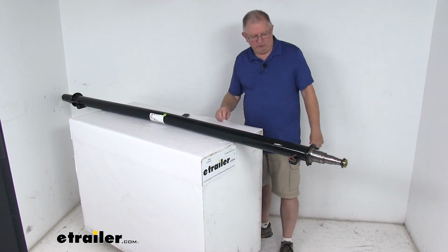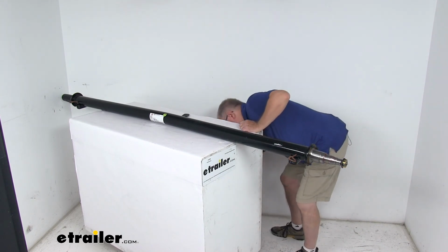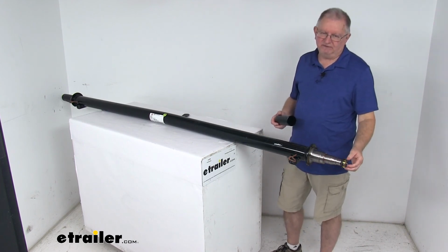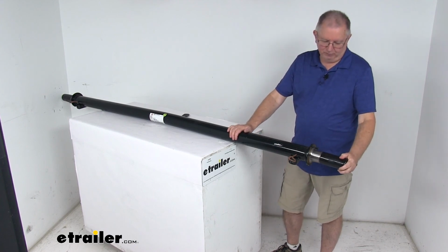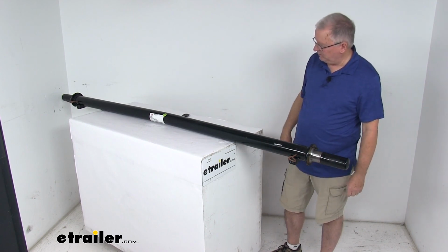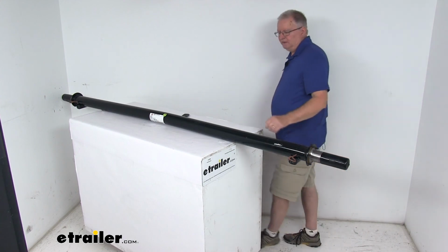Now one last thing I do want to mention is when we do ship these, we don't leave these unprotected. What we end up doing is we'll coat them with some grease to keep them from corroding, and then we have this thick rubber boot that'll slide over them, and that'll help protect them, and then rewrap it. So we'll ship it that way, and you can see the other one is all the same way. So when they're shipped out, they are protected from any damage.